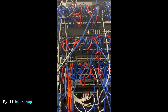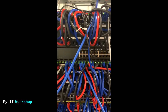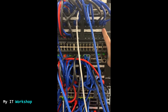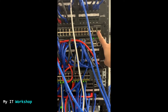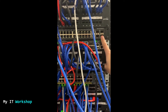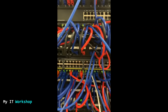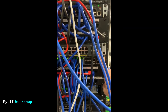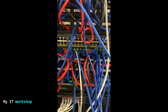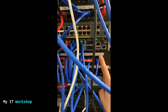Welcome to the server room. Here is the rack with the switches and patch panel — please don't criticize the cabling, that's not the point of the video. On top we have the first switch, an Aruba, and below it the patch panel. Everything on the first floor starts with 100. We also have a Cisco switch we're not using anymore, a second switch for the second floor with its patch panel starting with 200.